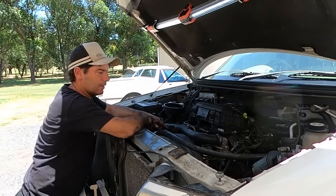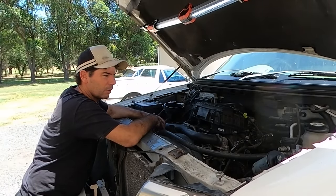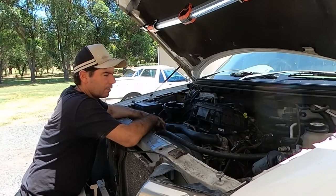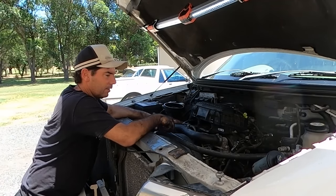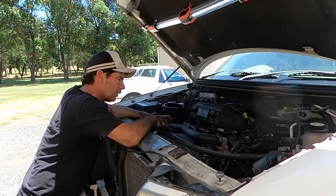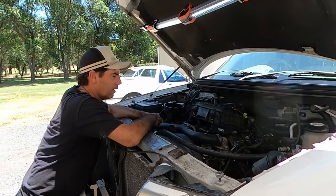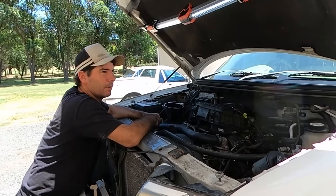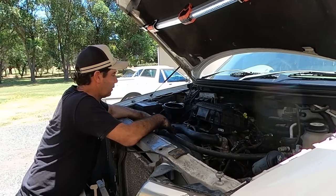I was told it had chains in it. It doesn't look like it's had chains. But like I said, what if it was 180,000 kilometers ago that it had chains? That would be consistent. They're not bad. I just don't think they look bad enough to be the original chains. At 480,000, if it hadn't had cam chains done, those tensioners would be flogged out.